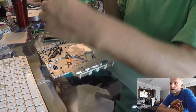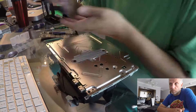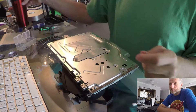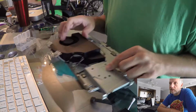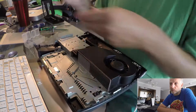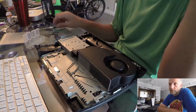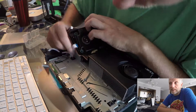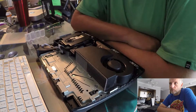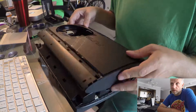To hold the heatsink and hot chips tightly in place, we apply a pressure plate — that's the one I'm fixing now. That's part of the original construction, so I didn't have to buy it. There's a second pressure plate visible just behind the big fan. I fix that with a single screw at the front — the part that looks like a tongue. Make sure all cables slot back in without force; they should be kinked as they were before. The disc drive doesn't sit in perfect position until the power supply is fixed, then the screw is tightened and the disc drive goes back into place.